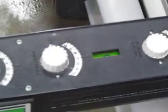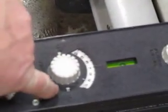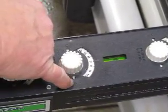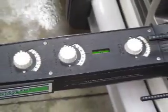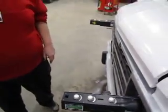There is now a number on my vertical measurement. If you follow that up, it says 7. And if you notice over here, there's some diamonds in this window. You'll notice there's a D over here and a U over here. So what it means is I'm 7 inches down. In this case, this headlamp is pointing 7 inches down.